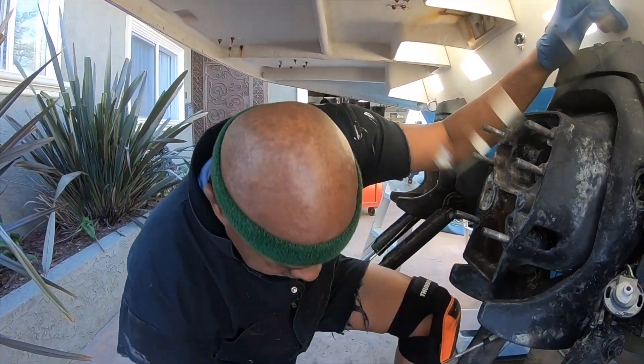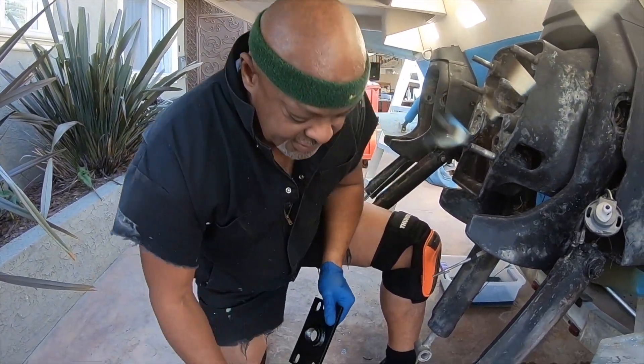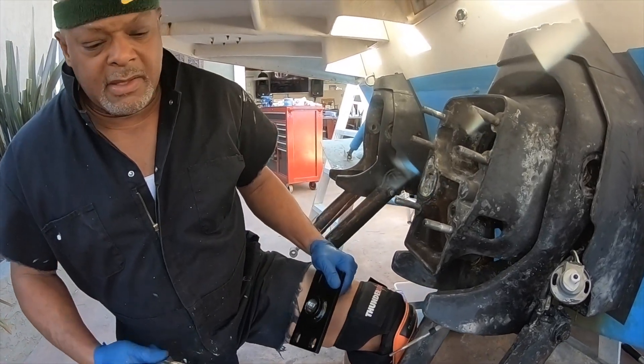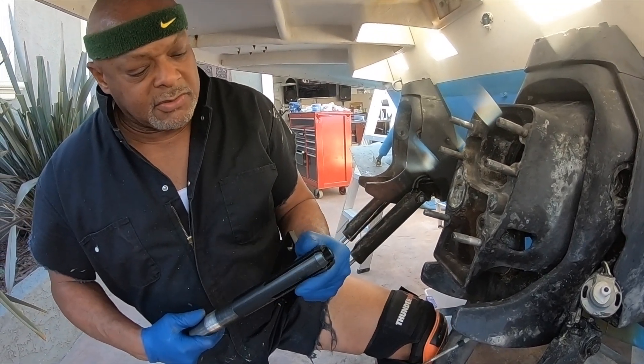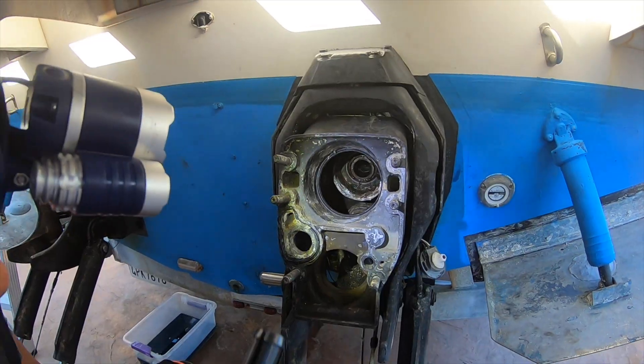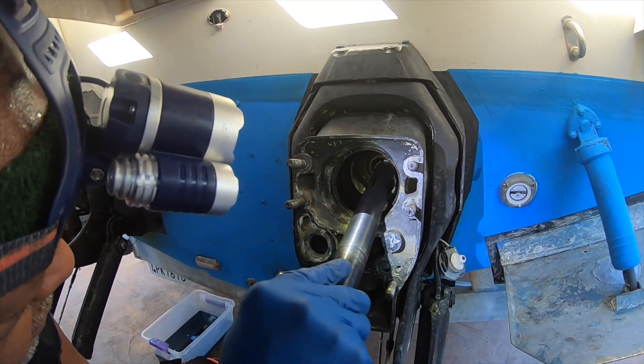What I'm going to do is show you the tool I'm going to use. This is a tool I got off eBay. This part goes inside of the gimbal bearing — how it works is this part goes into the gimbal bearing, these pieces squeeze, then it's going to pop out on the other side of the bearing. So it's over there, then this part goes on like this. This is the piece that goes in the shaft that spreads out those teeth so the bearing can't come out.